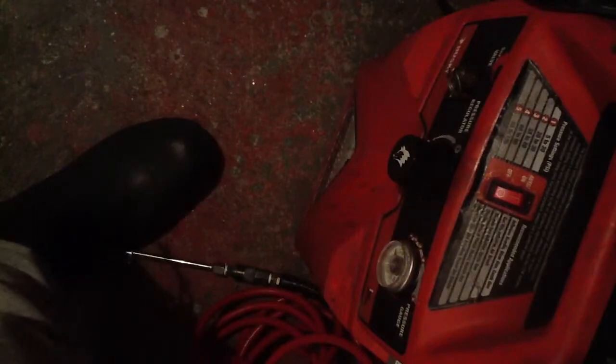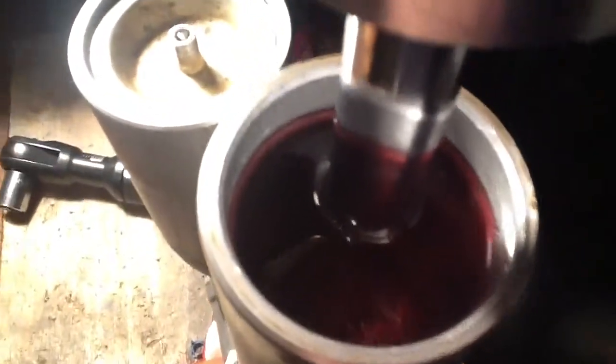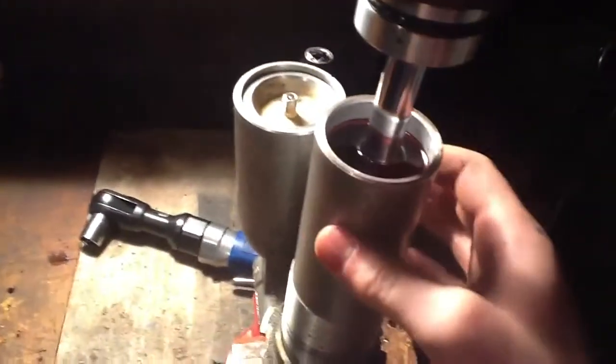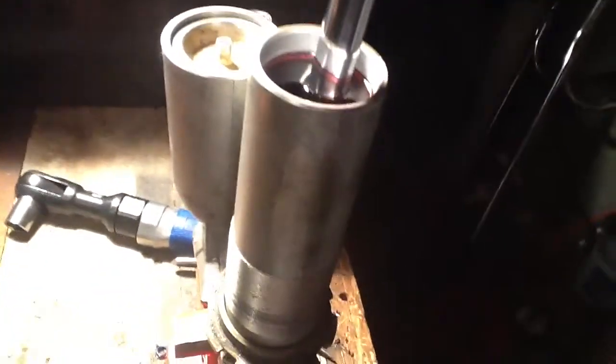Give me a second and I'll show you how else you can tell it's messed up. Listen to the noise this makes — I'm pushing down on the shock shaft right now. Then look inside: see all those little bubbles? That's from the oil slipping in between that bushing and the outer tube, and that's not good. It's basically got about 75% rebound ability right now.